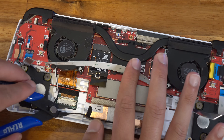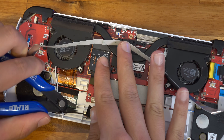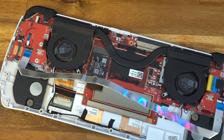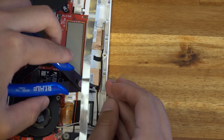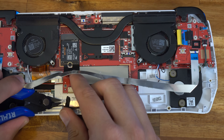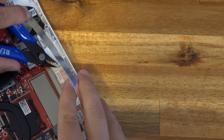The next part's a little intimidating. We're going to have to take those clippers and trim out parts of the plastic case to fit the bigger battery. These two little boxes here are going to block the larger battery, so just work slowly and use those cutters to cut those little plastic squares out. This seemed intimidating when I was watching others do it online, but honestly it's really not that hard. The clippers included with the battery kit did a great job. Just make sure you're not cutting any cables or scratching any of the PCBs, and take your time cleaning up all the edges — you don't want anything sharp to puncture the back of the battery.